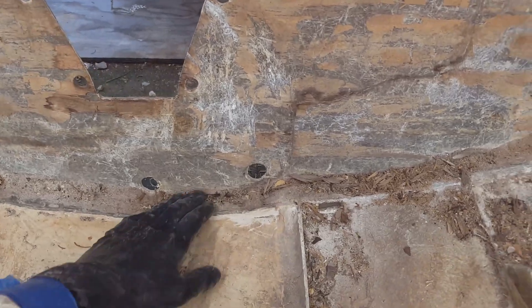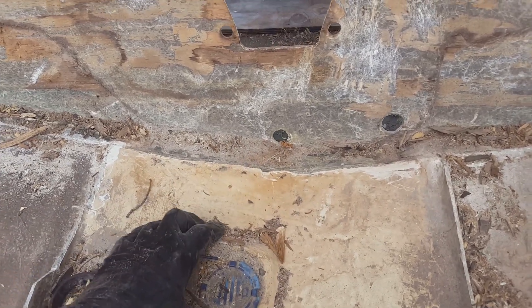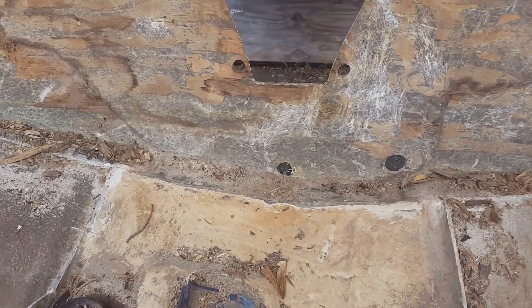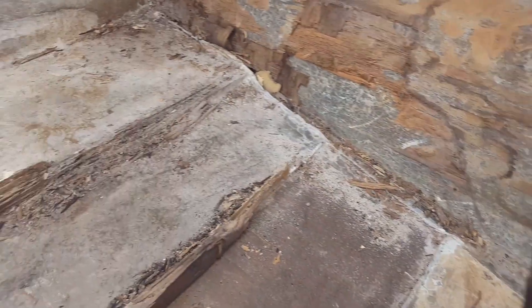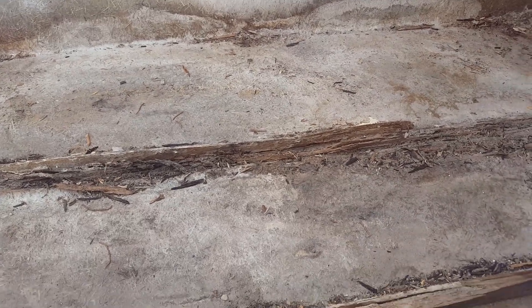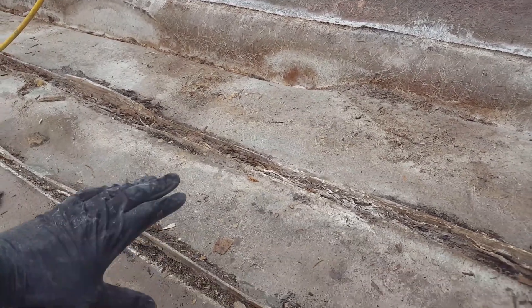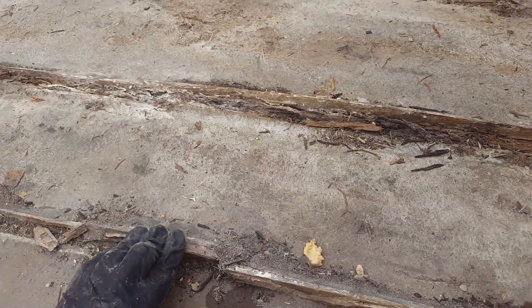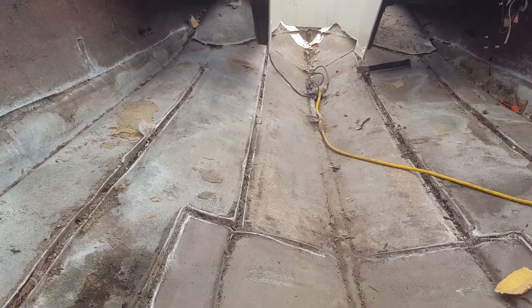The other thing is if you're working in an environment where there are animals around — say you're doing this in your backyard — you're going to want to catch all the runoff. That liquid fiberglass that comes out through your drain hole, where my old live well hole was, is going to pollute the ground below. Get a five-gallon bucket and sit it underneath that hole to catch it, so you don't pollute the ground and your wildlife doesn't drink it. I'm going to finish cutting off all the high parts and we'll continue with grinding in the next video.